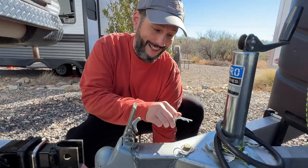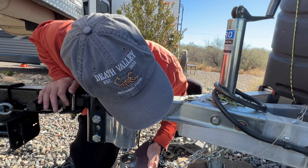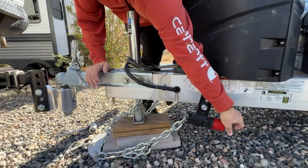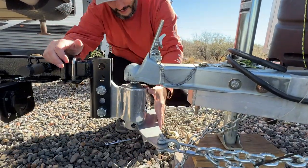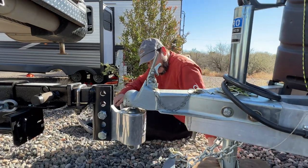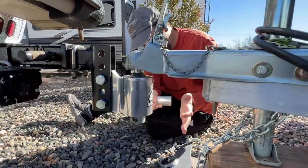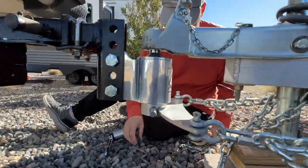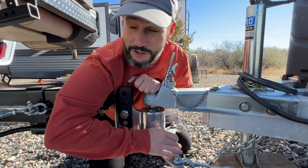We're actually running late, so I'm not recording a lot of this. I just dropped it onto the ball and haven't set this up in a while. We're going to get on the road and I'll record how the behavior works. If you're interested in how I hooked this up, it's in one of the other videos I'll link in the description. Also, if you have an Anderson hitch, people have found that when you back up at a slightly different angle it doesn't align. I found that if I take the back side, put it in the hole, and just tap it a little bit, the hole lines up.